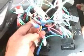It's quite convenient to attach the orange wire to one of the red wires coming from the back of the red pilot lamp indicator. It carries the 12-volt signal to let the system know when the warning lights have been used. So that's a great place to connect the orange wire.